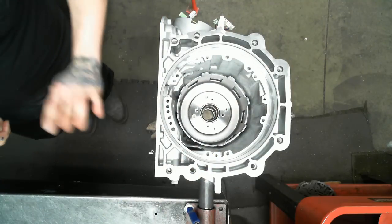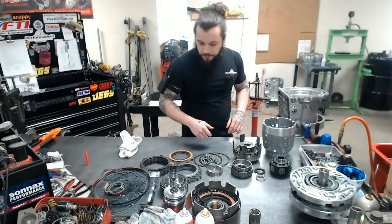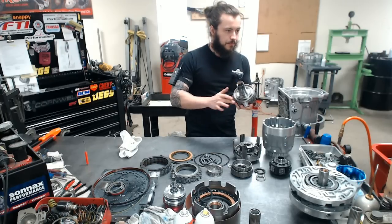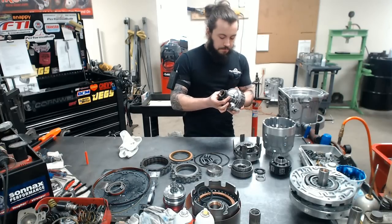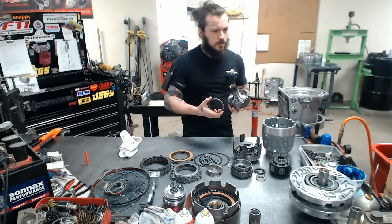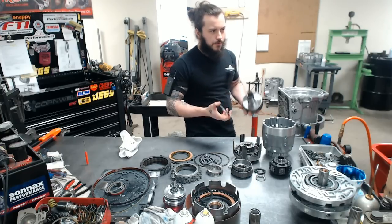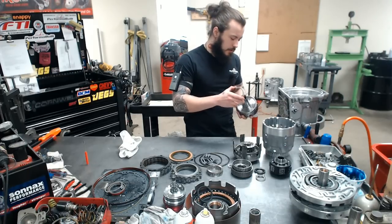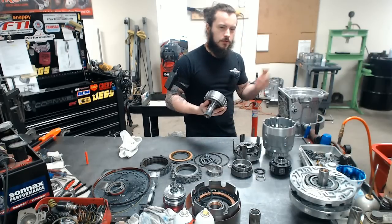Check your action, everything spins nice, and that just sets on top of your sun gear there. And the next piece would be the reaction tube front ring gear. And again, the bushings, the surface here, a bearing style is really nice. I firmly believe everything should be as free moving as possible, and even though a washer is all good, I just feel like this is a little bit better. It just makes sense. But the washers, they do last forever.